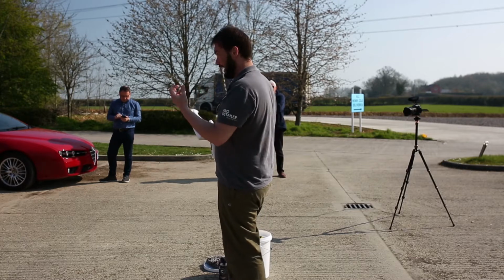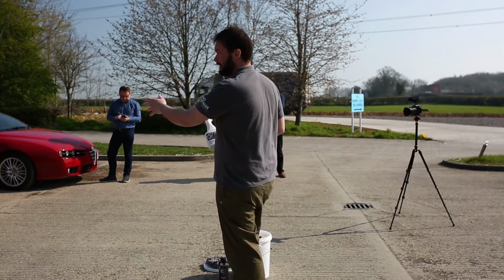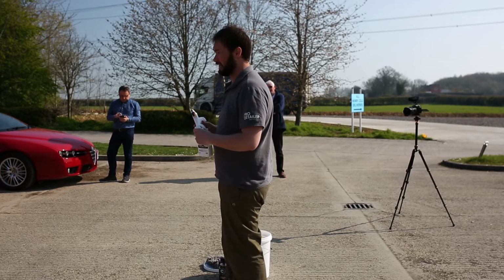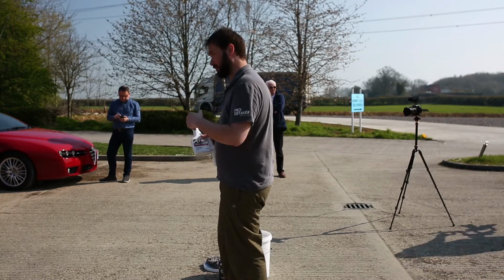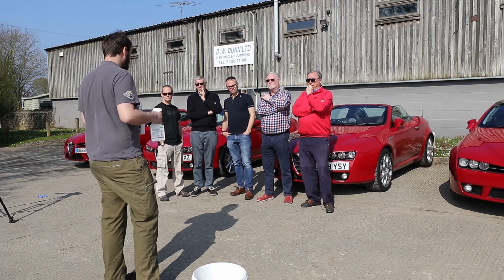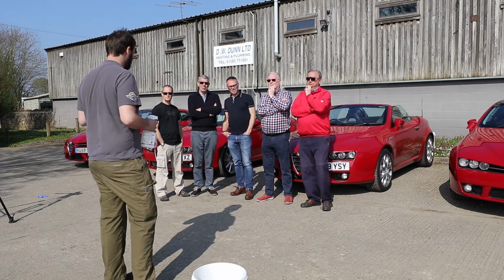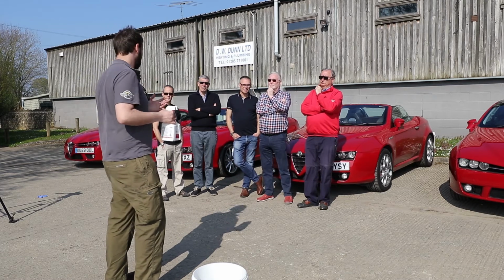Again, fallout is very small particles, normally Fe2, that come from your brake pads when they're abrading with your brake disc. They come if you live near a rail yard or industry, it's all in the air. And actually, some of it can occur naturally as well. And the idea is this breaks it down into Fe3, which is water soluble, which can then be rinsed off. So again, these are your decontamination stage. As I say, we've included some paperwork, some guides and stuff. And the idea is not to clay bar the car, which is the third element of decontamination, because it could really compromise the finish.